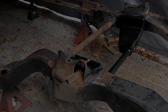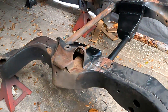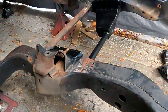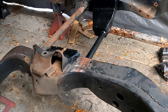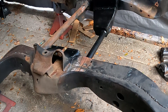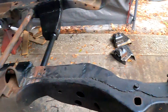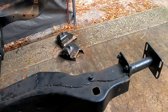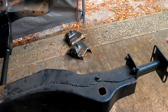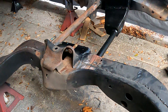I'm cutting the centerline here on both sides. I measured both sides as close as I can get, which is probably plenty close. We're going to get that cut right there, cut the front frame horn off, and then bend our tube. I already did a measurement from here over to the end — we're about an average between the two sides of 28 inches. I was told to get it as far forward as I can, so here we go.